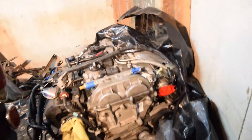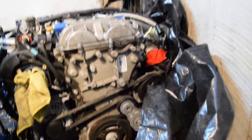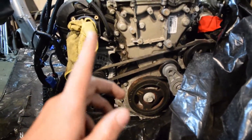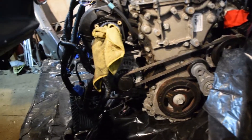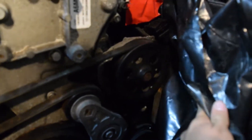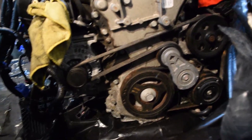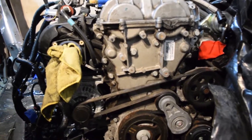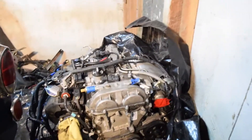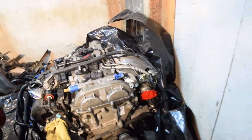I think it's going to fit alright. The problems that guy with the P1800 had — those LNFs were kind of mid sump so he had to cut quite a bit of the cross member. With this I don't think I'm going to have that big of a problem, it looks like it lines up. My biggest concern is the alternator and the water pump — I think the water pump is higher up so it's not that big of a deal. I don't need the AC compressor so I'll get rid of that. It's a drive-by-wire system so I'll be able to put the throttle pedal wherever I want, which is good. They're a little bit laggy compared to a cable but you can fix that with a tune.